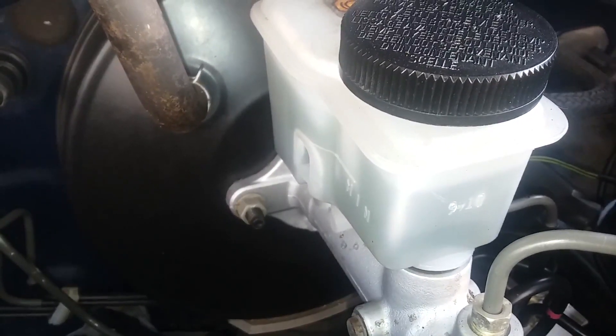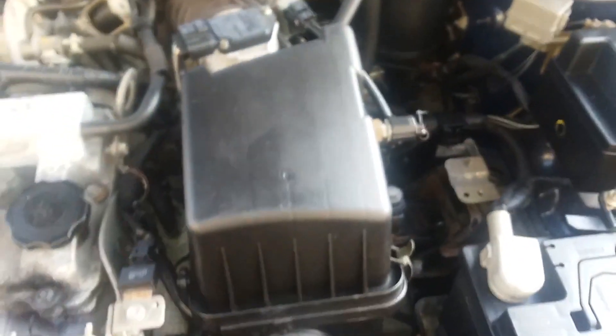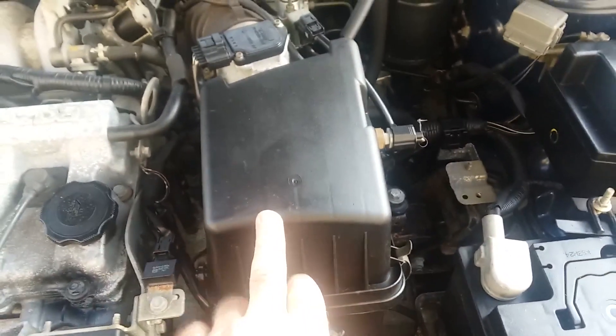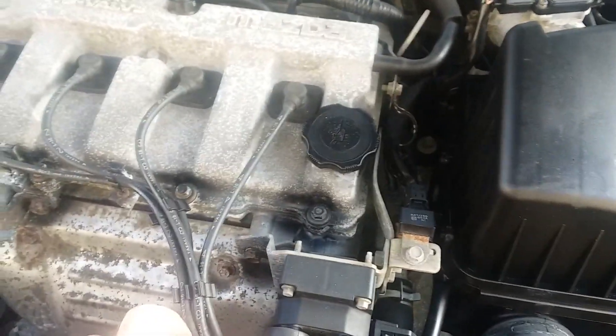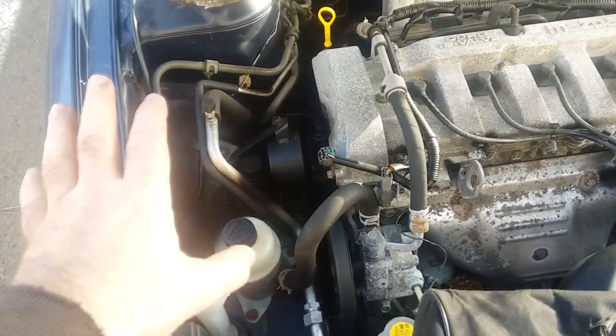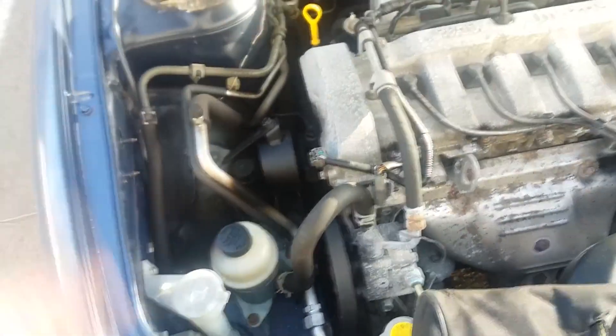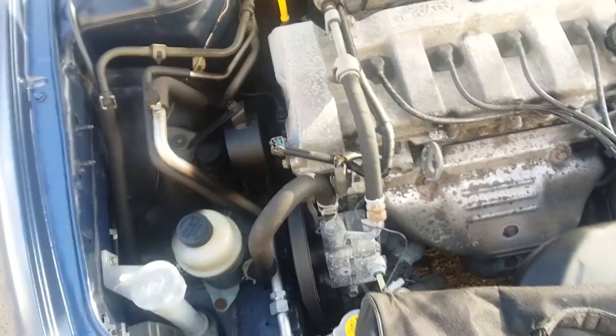Always take a look at everything. His brake fluid is dark green — that needs attention. The air filter also needs to be changed; there was a cloud of dust that came up from it. The oil looks clean and he has enough oil. The power steering fluid smells slightly burnt, but only slightly. He's only going to have this car for several months as they're contractors here, so that can continue as-is.